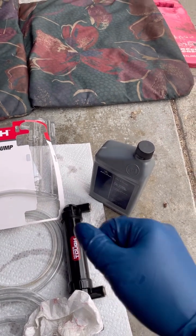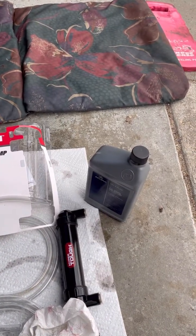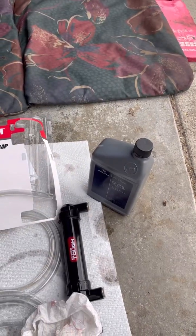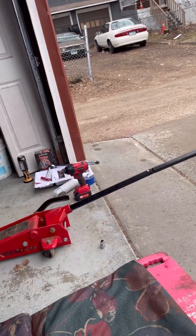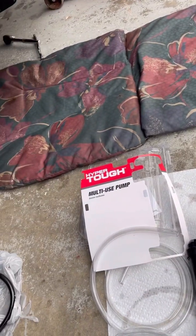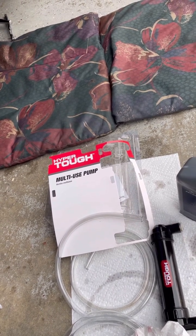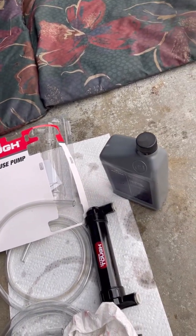The key thing is to pump it until it runs over, then catch the overflow, and tighten it back up. Again — 35-pound torque on the torque wrench. And that's it. That's how you do your differential fluid change for the Acura RDX. I have the 2022, but I think 2019 to present applies. Be well guys, bless.